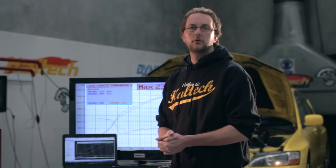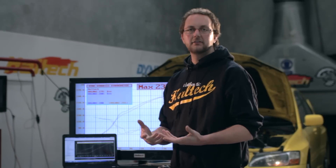We've also got our Haltech data logging set up beside us here on the laptop. We'll have a quick look through and check the boost pressure versus RPM to see why the engine made more power through the mid-range and compare the open versus the closed loop boost response.